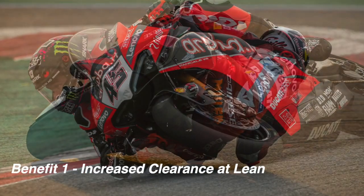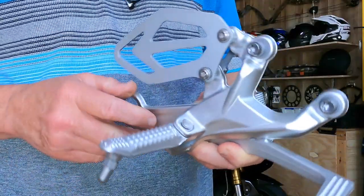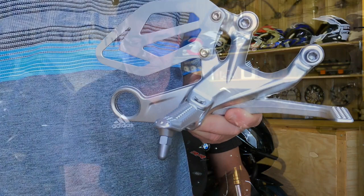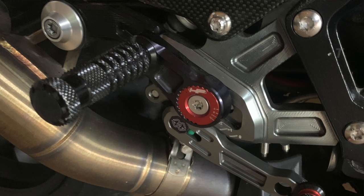The obvious benefit is greater clearance. The factory original BMW S1000 foot pegs pivot — when you lean the bike far enough that the foot peg touches the bitumen, it folds up, with a little rubbing knob meant to touch first. With rear sets like the ones on the BMW here, the foot peg is screwed in hard and doesn't pivot, because the clearance is now so much greater. If you do touch down, you're probably going to fall over anyway.